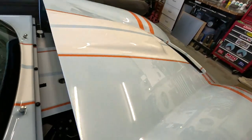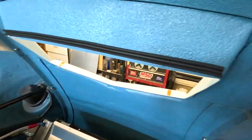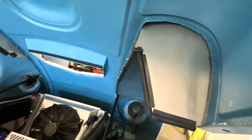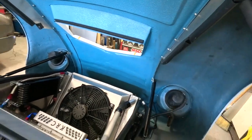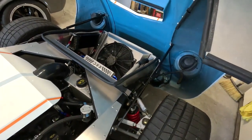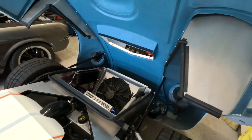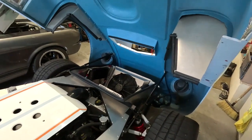Let's pop this hood open - voila! This is the adhesive rear hatch weatherstripping I used. The gap is about 600 thou and this stuff is about 650, so it's just enough to keep the air from jamming up in there. I'm still going to get just a little bit around the edge, and I'm not really sure how to seal that completely - it probably needs to be bent forward or something. But we put that strip across and that'll keep air from getting up inside of here. That solved aero problem number one.